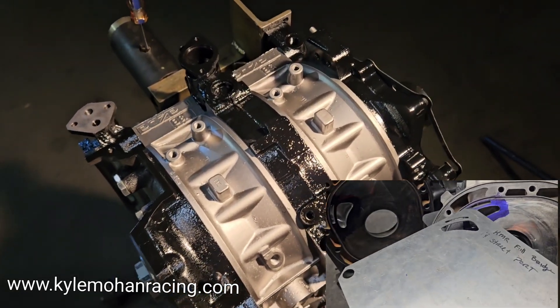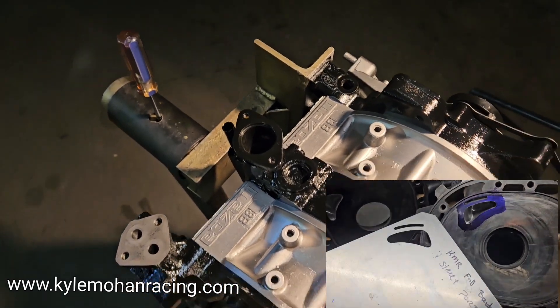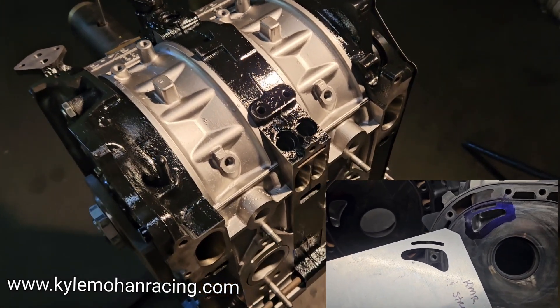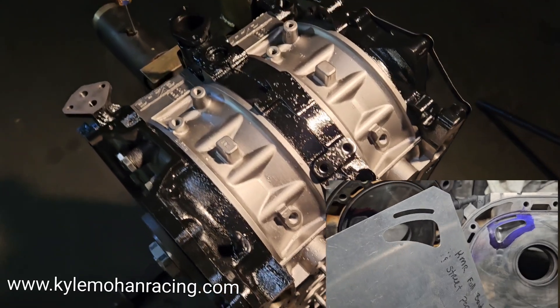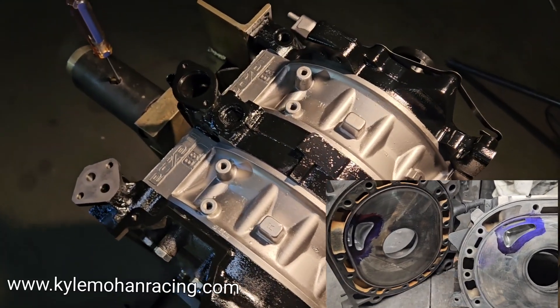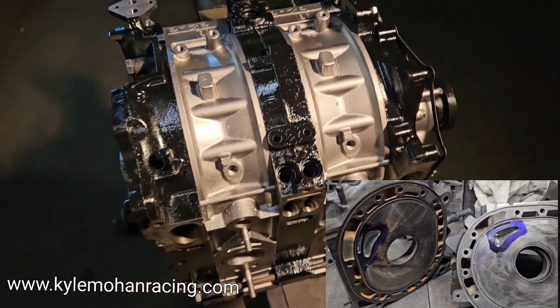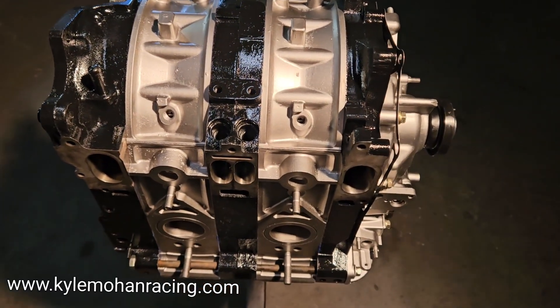You're also obviously going to be using more fuel. It's going to have more wasted fuel and it's going to not idle as low. But traditional bridge port motors — full bridge ports — were always originally designed for racing, but they've kind of transitioned into performance, drifting, drag racing, street performance, just having a good time. A lot of show cars run bridge ports these days.